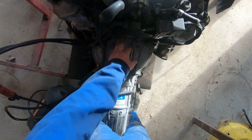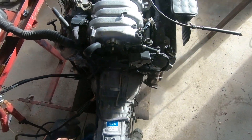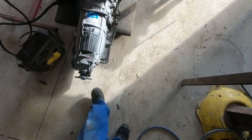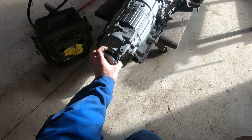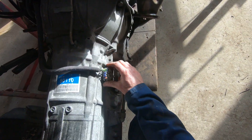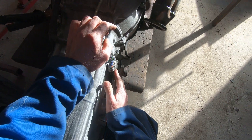For the starter I made a new loom, and that runs up to a firewall grommet — I'm expecting the battery to be in the cabin. For the transmission side of things, we've taken off the three-bolt flange on the back and fitted a round flange, so that'll accept a flange that we make up with a slip joint in the drive shaft.